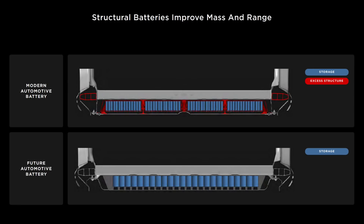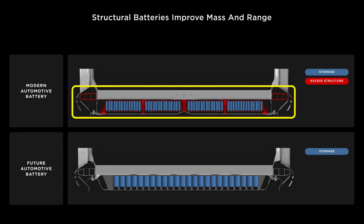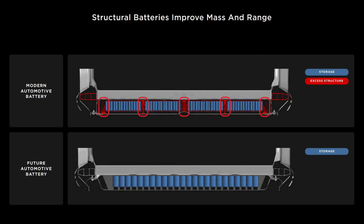Let's move on from a conventional ICE vehicle to the image Tesla showed at Battery Day. Currently, Tesla's battery packs carry the cells as cargo. There are a series of cross members and a surround, which are both steel and marked in red. The cross members run longitudinally from the front to the rear of the pack and the surround wraps around the pack. Basically, it's a steel box that holds battery cells and the cells themselves are under no stress. That steel box replaces the structural floor pan to provide torsional rigidity. Not only do Tesla's current vehicles have a rocker, they have a steel surround at the perimeter of the battery pack and the longitudinal cross members — the rocker, the cross members and the steel surround are all doing the same thing, connecting the front of the vehicle to the rear and providing rigidity along the length of the vehicle.